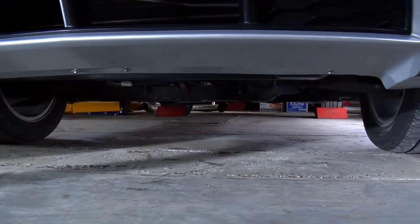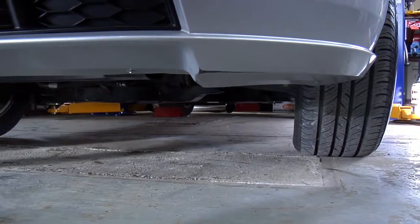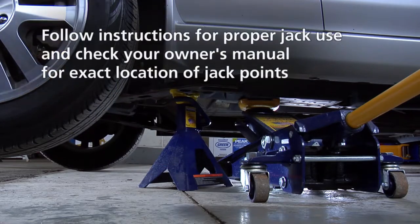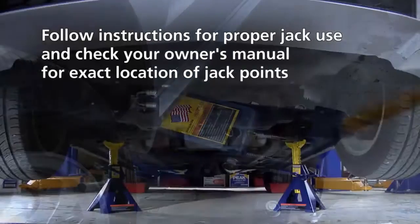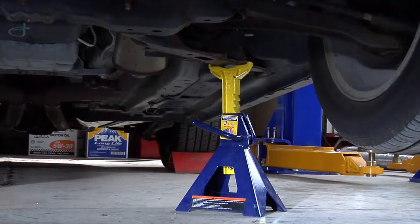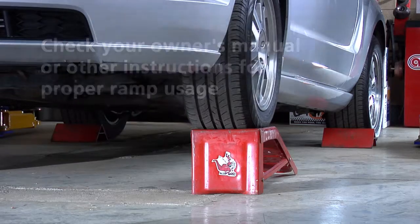Okay, you're going to have to get at the drain valve. So you have to determine if you need to raise the car up to get underneath. If you do, you can use a jack and jack stands. Never get under a car that is held up only by a jack. So, raise the car up with the jack, then set it on at least 2 jack stands. Always use jack stands. After all, it is your head. You can also use drive-up ramps with rear wheel chocks.